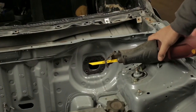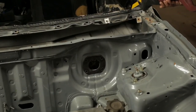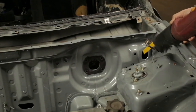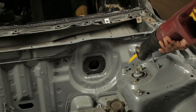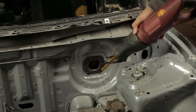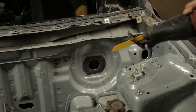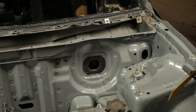So real quick, I just wanted to explain what's going down. I want to make a cut from the driver's side through where the windshield goes, past this bracket where the wiper motor bolts, and come right across and down into this hole — which is a factory wiring harness hole. Once I get to that hole, I'm going to go toward the clutch master cylinder hole, then horizontal across, underneath where the brake booster usually bolts up, right on top of where the steering column passes through to the steering rack. Then I'll go all the way to the middle of the firewall, and I'll switch the camera and explain the other side.